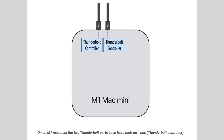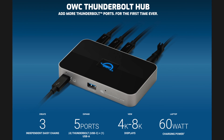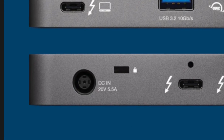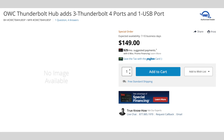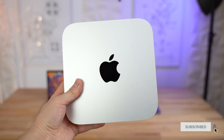Thankfully, the folks over at OWC found out that each of those Thunderbolt ports on the new M1 Mac Mini actually has its own controller, which apparently supports Thunderbolt 4, so each port can actually support two extra Thunderbolt ports using their brand new OWC Thunderbolt hub. You can turn one port into three, with the possibility of having a total of six Thunderbolt ports on the M1 Macs if you buy two of those hubs. They do require DC power, so it makes much more sense on the stationary Mac Mini. Interestingly, OWC says this hub supplies up to 60W of power, so you can just replace your MacBook's power adapter with this hub if you need the extra ports. We'll leave a link in the description below — we already pre-ordered one and will be testing it in-depth for our full M1 Mac Mini review, so subscribe if you haven't already!